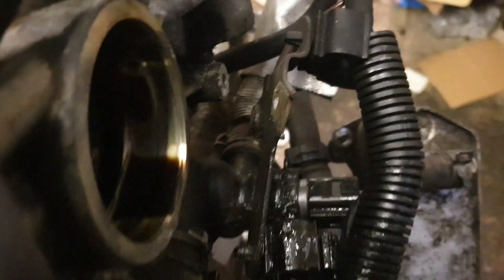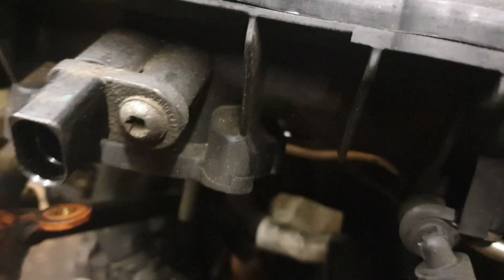Rather than disconnecting them one by one - which makes the process long - once you've removed everything from the intake manifold, get all that mess out, just pry on it and it will come off. Once you've got it out, it's just held by a few sensors and a few clips, and it'll all come out. It's very dirty and messy down there so put a rug down. Be careful when pulling it back so you don't damage anything. Just move this stabilizer out of the way - it's held on with a 12mm or 13mm and then an M10 triple square - and move that oil feed pipe that's clipped on; spin it with a mole grip at the bottom and move it away.